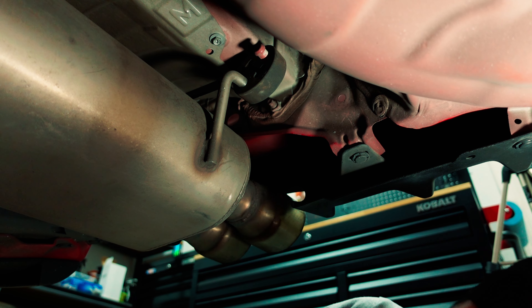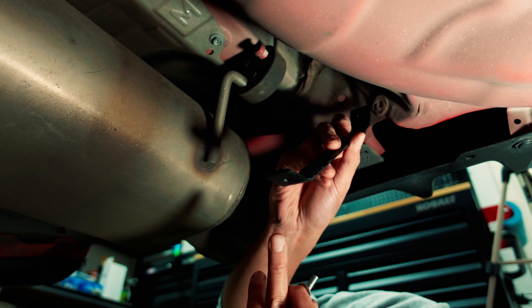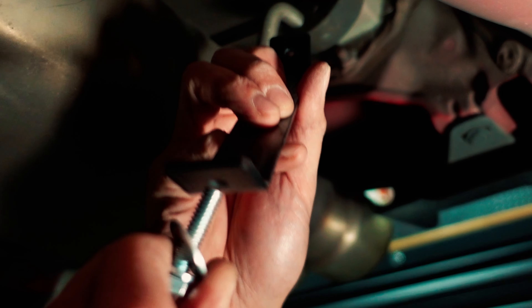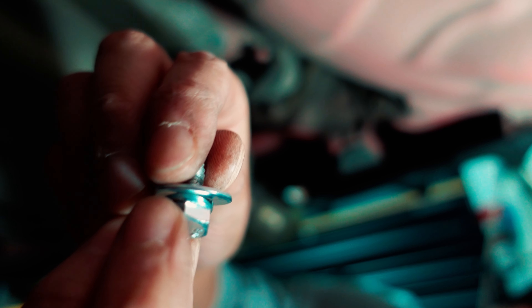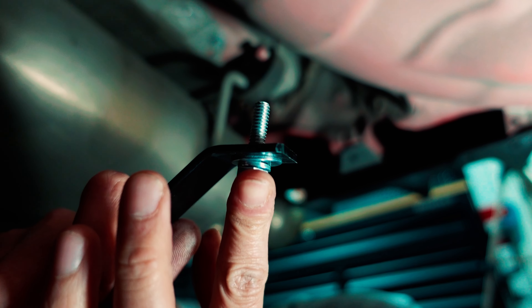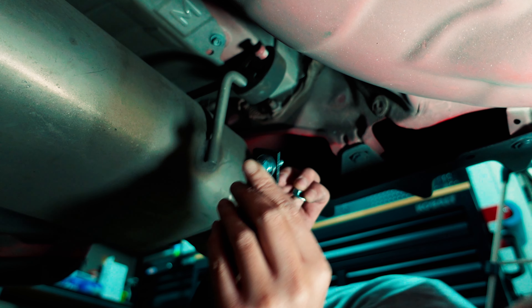The first hole is right there. Take your bracket — if you're ever confused on which side goes where, remember the bracket should be facing towards the front of the car, and the side that goes into the car body is the non-threaded side. The threaded side is where the actual diffuser mounts. Slip it straight through, then the order is: bolt, then the compression washer, then the bigger washer. Slip it on the bracket and mount it, then on the other side get your washer and nut to hold it in place.